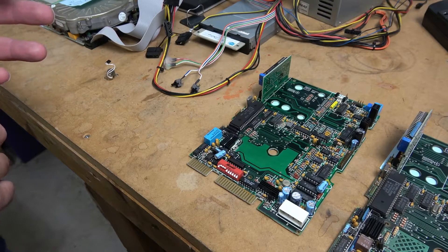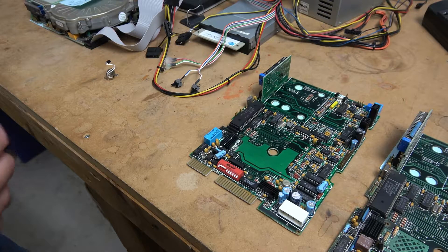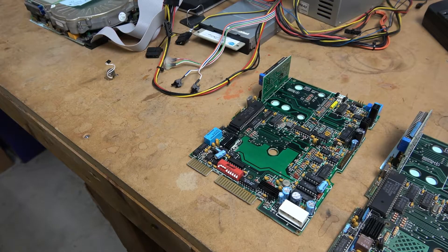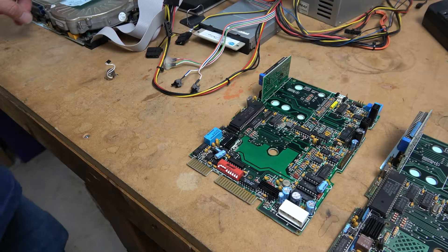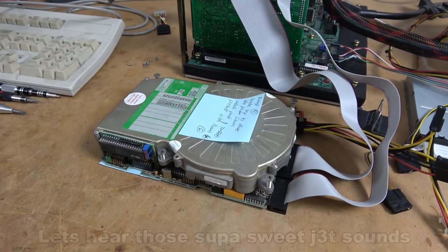I have a 1050 that when you power it on the heads go nuts — it sounds like there's something loose inside, so that's going to be a bad drive because there's something physically wrong with the internals. I have another 1050 — the one I pulled the control board off to fix my 1060 — and when I did power that up it would spin up, try to activate the heads, make a couple of clunks, and then power down. That's because there's something wrong with the power-on sequence, and it's really just a protection built into the drive to keep it from damaging itself. That condition exhibited itself on three drives including this one on the test bench.